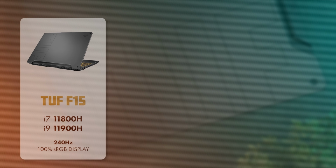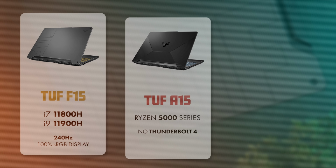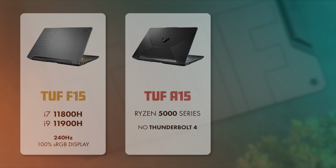Within the TUF F15 range, you can get the i7-11800H as well as the i9-11900H, both being octa-core CPUs. The highest end model also comes with a better display, which supports 240Hz refresh rate and 100% sRGB color gamut. The TUF A15 range is identical to F15 but with Ryzen 5000 series CPUs. It doesn't have a Thunderbolt 4 port but a USB 3.2 Gen 2 10 gigabit Type-C port. Everything else, including design, is pretty much identical.